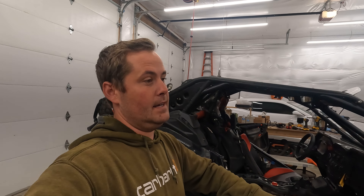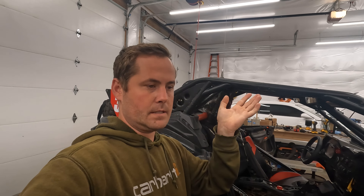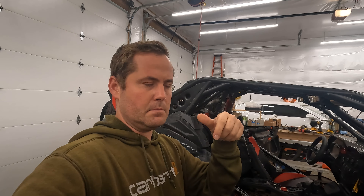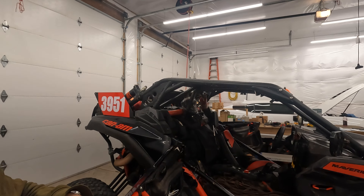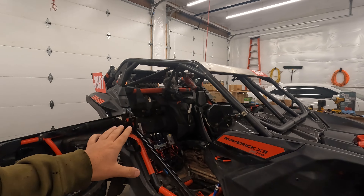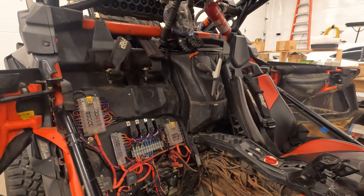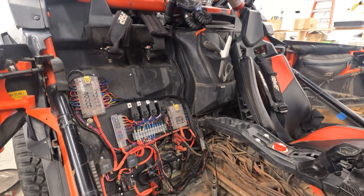So we're going to actually fix it. I ordered from EVO an 850-watt upgraded stator and voltage regulator, along with all the gaskets. I'll put a link in the description below. Because of all the Baja Designs lights, extra fan, and electronics we run on this thing, I really wanted to just do it once and do it right. We're trying to get ready for our race in two more weeks.